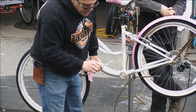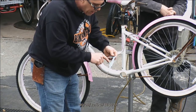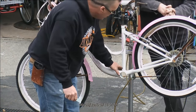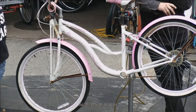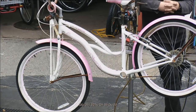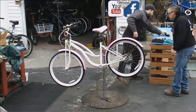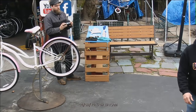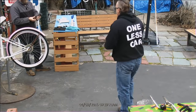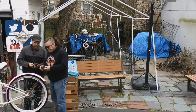It's about 67, 68 millimeters. I'm looking at the bottom, the zero. I just need a ballpark. That's cool, 68. A mountain bike or some other bicycles are a 70 or 73. The bottom bracket accordingly can be a 73 shell size or a 68 shell size. Do you have the box? Oh yeah, there it is. This happens to be a 68, right? Yep, it is a 68 by 127.